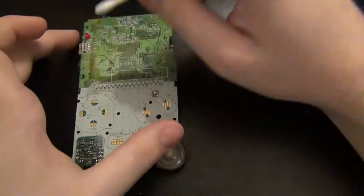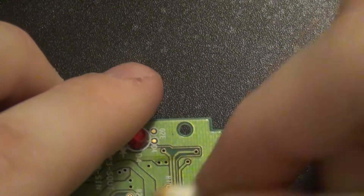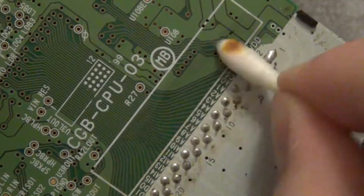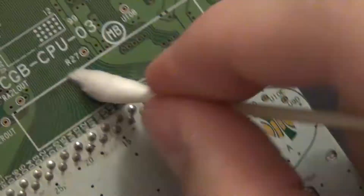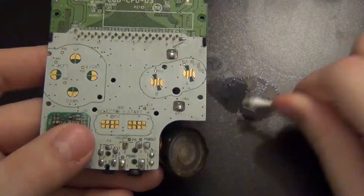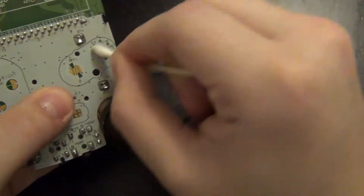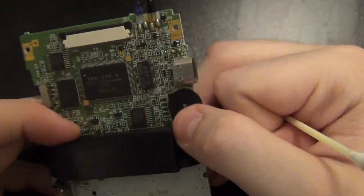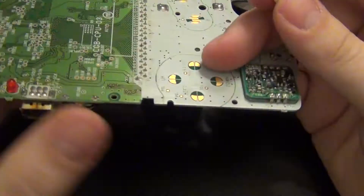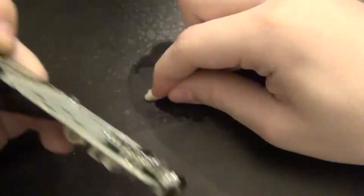I thought the orange-brownish material was rust — it might be, might not — but I went ahead and took some IPA and cleaned it. I started off with the rust spot, which was shaped like a big L of sorts. I ended up cleaning the serial number on the motherboard in the process, but oh well. There's a white color to the pins here that looked corroded, but thankfully it was not. I then cleaned up the buttons and membranes, took some more IPA and cleaned the switches, knobs, and ports as well.